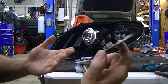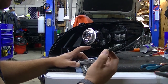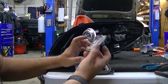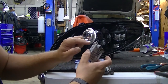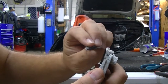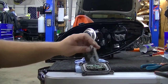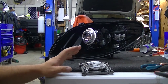I ordered a replacement ballast off eBay — it's new old stock, same OEM brand. These are normally sealed units so water usually doesn't get in them, but this one was very corroded. There's a crack in the housing right here — it cracks from the expansion caused by corrosion, the aluminum expands and then cracks, and then water just flowed right in, ruined the ballast, and blew the bulb as well. The eBay replacement was about $40.